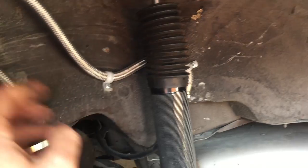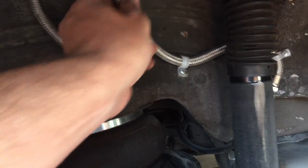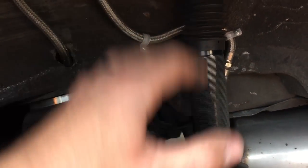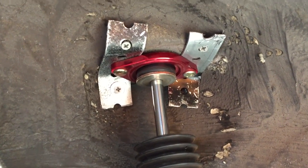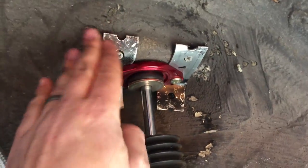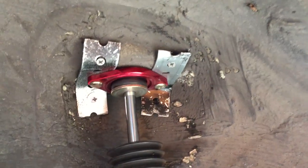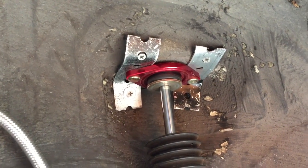Here's my airline — you want to make sure to use something like these plastic clips that allow it to move as the suspension geometry goes up and down. You want to make sure this is not hung up. And here is my makeshift fabrication to ensure that this thing was gonna make it here — just a couple of straps I screwed in and tried to bend. We're going to be removing this shock pretty soon.